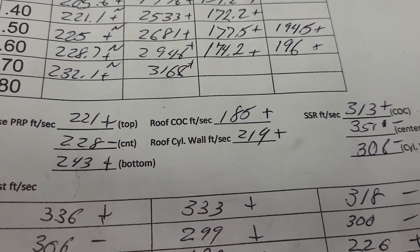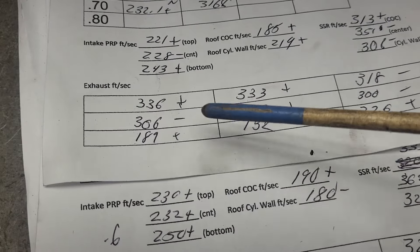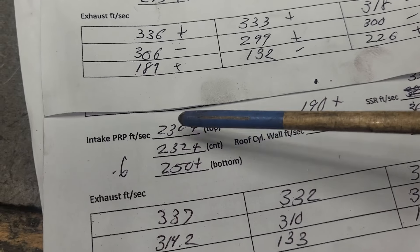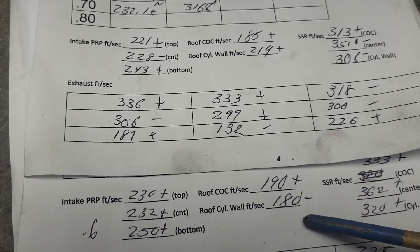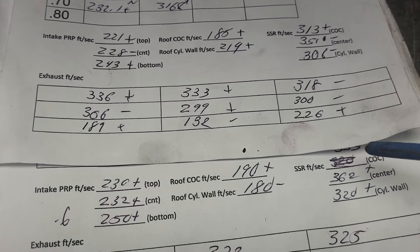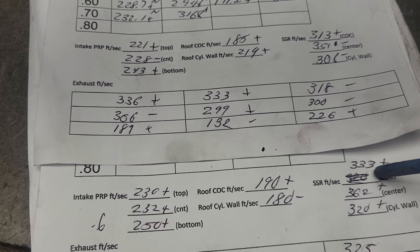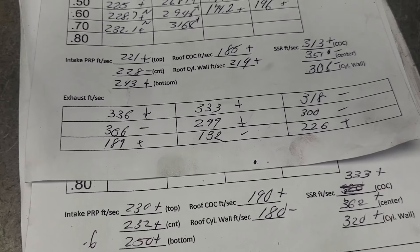First cut intake air speeds versus second cut: we're at 228 here and 235 here — you'd think they go up and we get a plus, minus, plus. Not bad from top to bottom, pretty active floor. Looking at the correct data now: plus, plus, plus — up from where we were. Here we've got a plus and a minus, fairly even — much more even than before. I'll take that as a win. On the short side: plus, plus, plus, plus. How even? Not bad. We've got a little more speed right where the flow ball said we had the most speed, because putting the flow ball there caused the flow to drop the most.